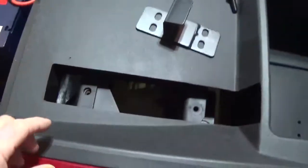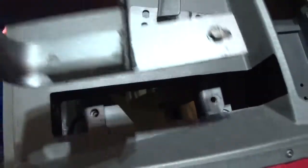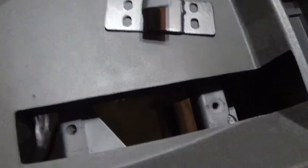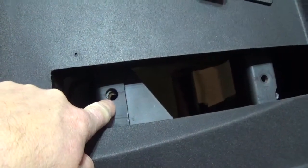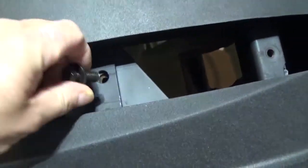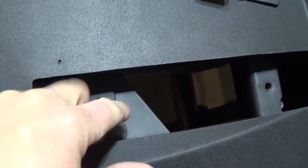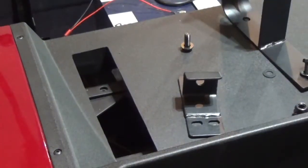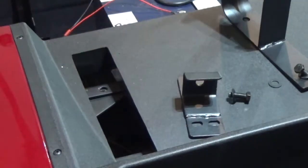One quick problem I forgot about. When I redid the battery tray, those supports actually used the same hole as our bracket for our seat. When I redid the bracket for the battery tray, it got moved over just a little bit with the welding and whatnot. So the bolt doesn't want to quite line up just right. I'm going to massage this a little bit with a die grinder — make that a little bit bigger so that everything will line up perfect. Well, that didn't take much, just needed a little bit. That way these bolts and everything will drop in there just perfect.